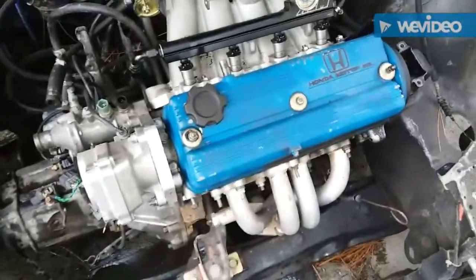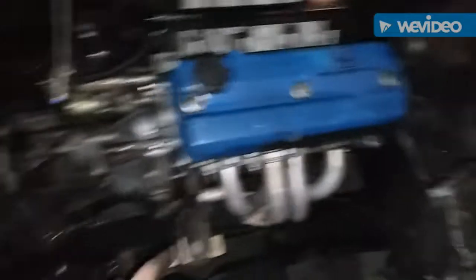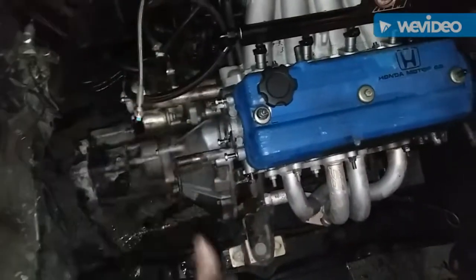We're making a little progress — got the radiator and stuff moved, a couple hoses, got the clutch cable loose, most of the harness is loose. Working on getting the rest of that out, removed the dog bone. Both axles are out, shift linkages undone. I went ahead and removed the center beam under there. Everything is disconnected. I'll wait till tomorrow to hook up a chain and we're gonna yank this thing out of here.